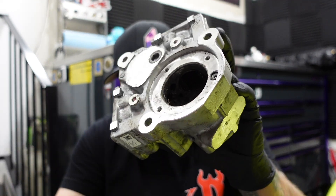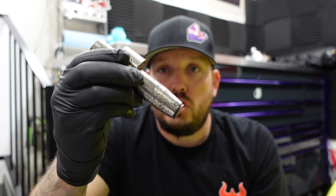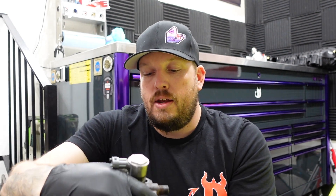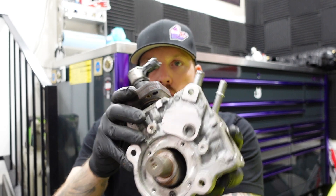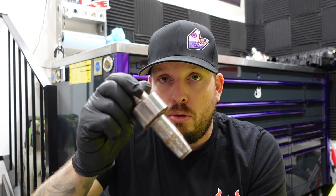There are two rollers inside, and the shaft will spin and push the rollers up and down. They're seized — I can't do anything with them. It's going to push onto the head units and generate pressure, giving you high pressure out of both sides. There are two of these little head units that create your high pressure. You can see how pitted that is — it's very tight clearances, so any issue with the fuel is going to cause a problem.